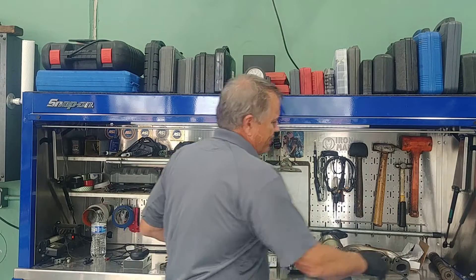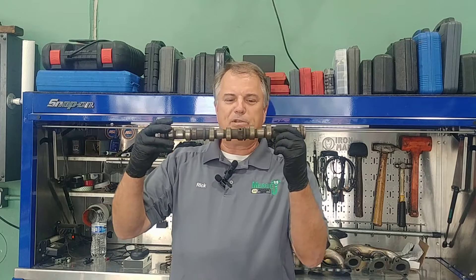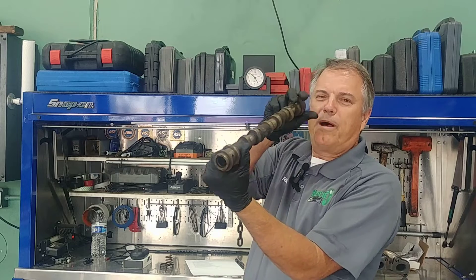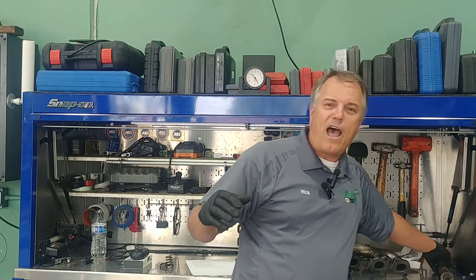On your vehicle, we have a camshaft, and the camshaft rolls around — if you can see, there are these little bumps on it. Those bumps on a Chevy engine make a lifter go up and down, to a push rod, to a rocker arm, and eventually that opens and closes the valve. I don't have a valve with me today, but they look kind of like an overgrown golf tee. And to close that valve we use a spring.